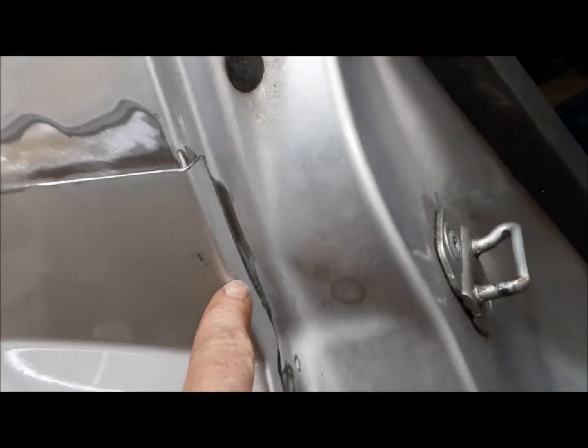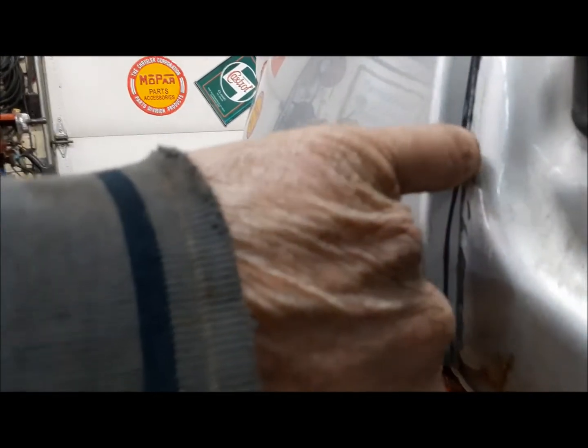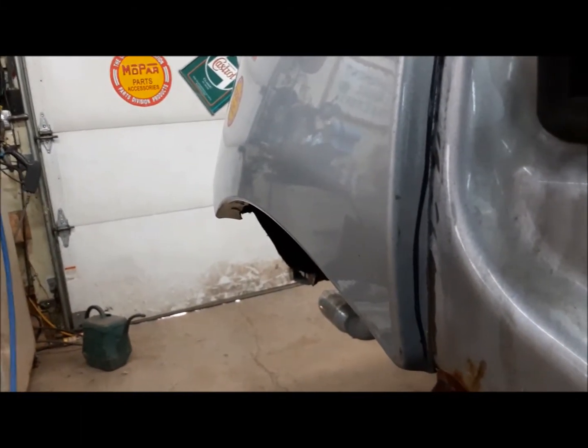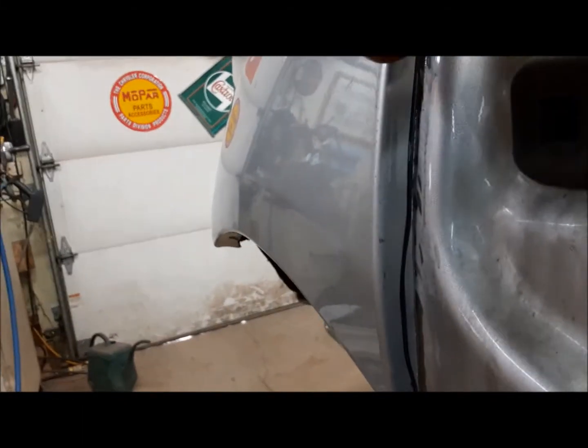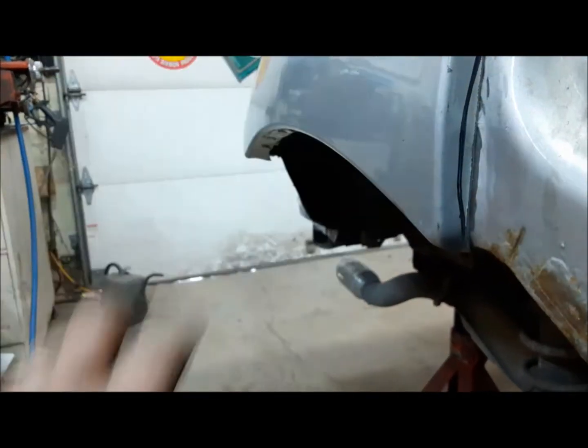What we have to do right now is get this end fit. I need to cut it back a little bit more so it's not bottoming out on there. And then we'll nip this and flange the original sheet metal back in a little bit, so we've got something to weld to, but it's not going to keep the panel this way - we want the panel back that way where it's supposed to be.